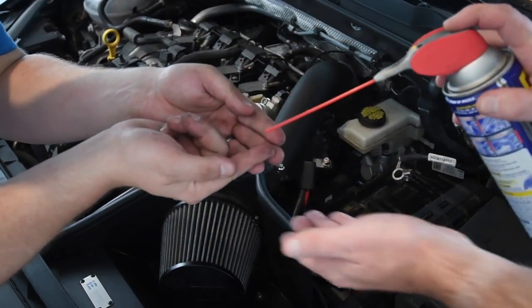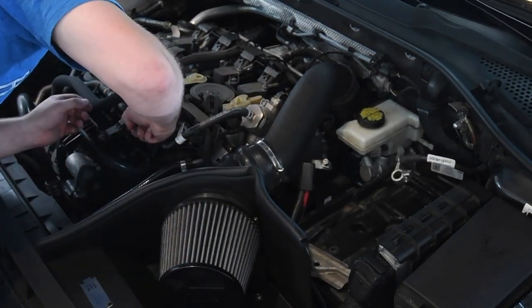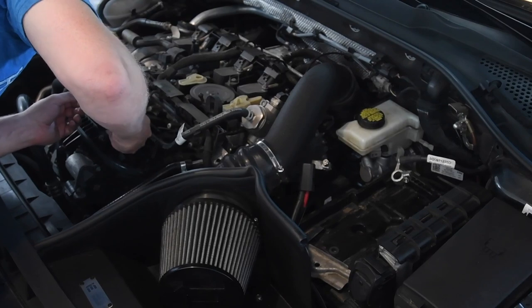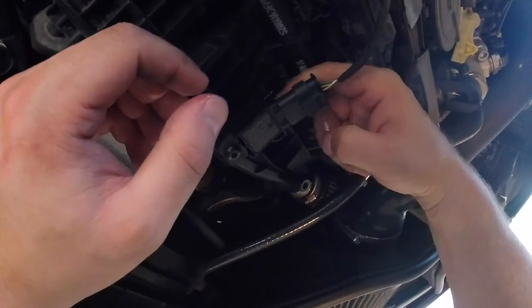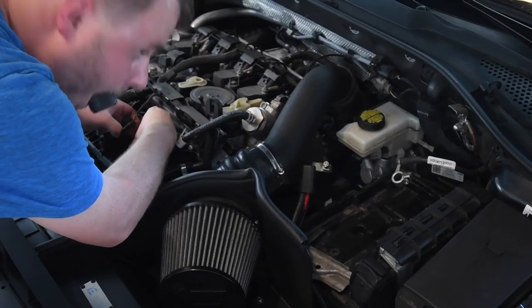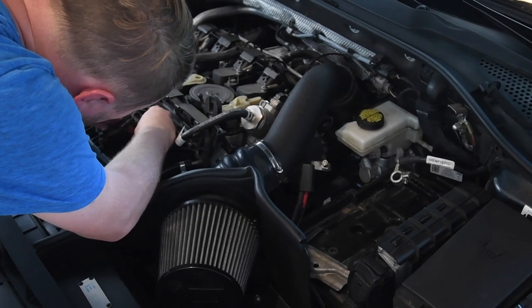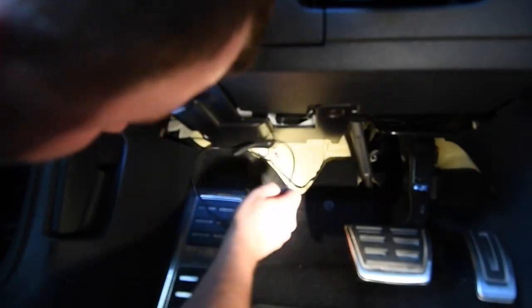At this point I just take a little WD-40 — this is optional, but it helped me get the vacuum line onto the boost tap a little bit easier so I didn't have to struggle as much. I double-checked to make sure the vacuum line didn't fall off the boost tap. You'll definitely know if something happens and the boost line comes off.